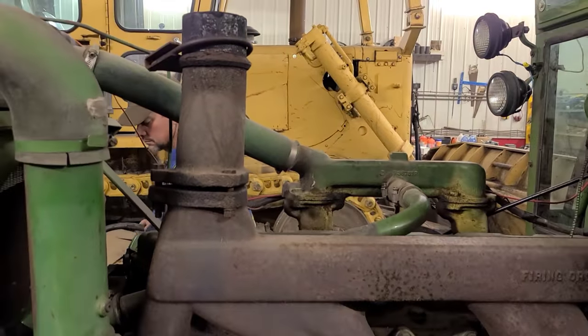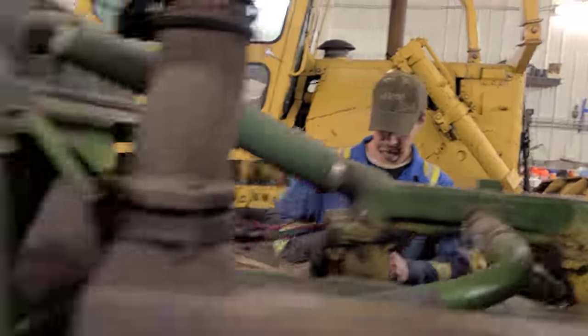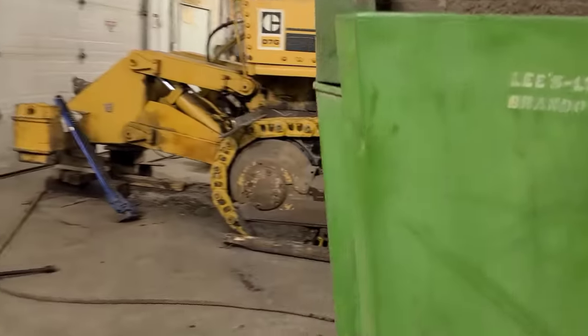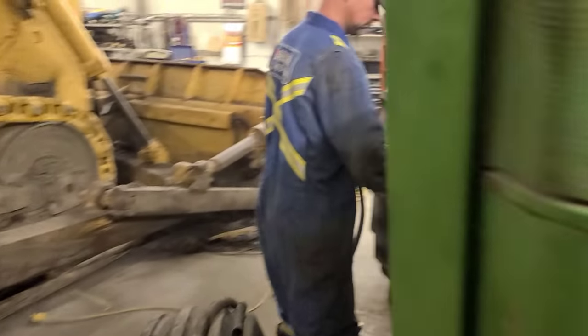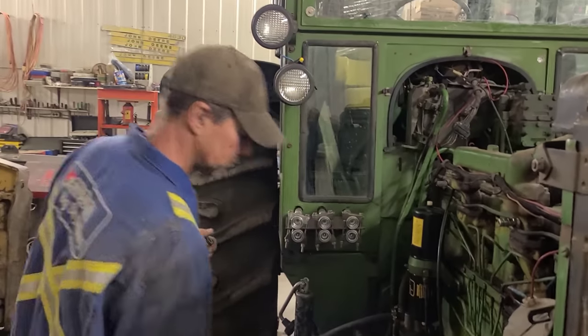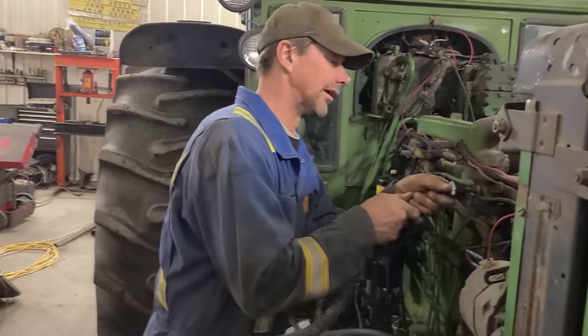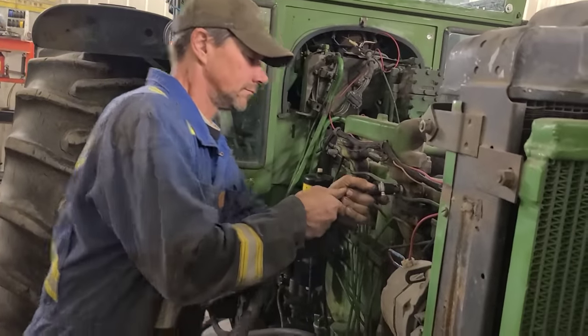You can disengage everything for the PTO in the back to make it easier to start when it's cold. And that had been turned, and since I've never touched that on any of our tractors in all my life, and nor has Dad, it never even crossed our mind to look at that, and it turns out that it was actually turned. So the tractor that was bought with PTO issues actually didn't have issues at all. Wow. So far, we'll find out when we put it on a bale shredder and make it work a bit.